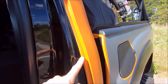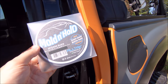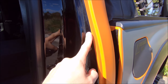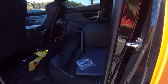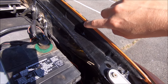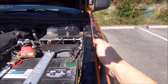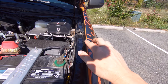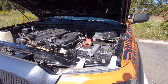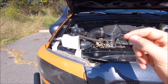If you have wrapped your truck and start noticing edges where the wrap ends and contacts another surface, you can get this stuff called mold and hold. It's sort of a satin black special tape — you do it overlapping all the seams, half on the wrap and half on the painted surface, just to keep that folded down. I actually use some under the hood since stuff's always getting kicked up under there. The sharper the angle, the more tension on the wrap, especially if done incorrectly. So if your truck wrap is peeling relatively soon, that's usually a sign you took it to a bad place. It's about 10 bucks — I'll put a link in the description below.